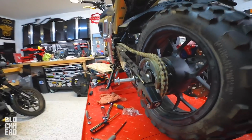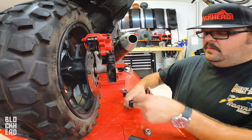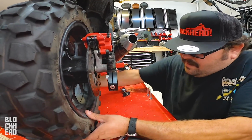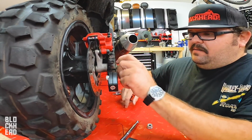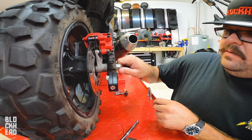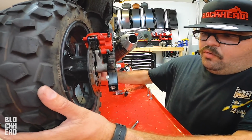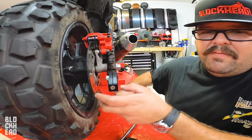All right, let's move over to the other side. Round 2. Wow. Old and busted. New hotness. Fits in there nice. Look at that. Got him. You put this little guy back on, and then this little guy back on, and then usually there's a torque spec. You put a little bit of torque on the axle so that you don't get too much side-to-side movement, and then you back off until you have maybe half an inch. We'll go with half an inch of slack.